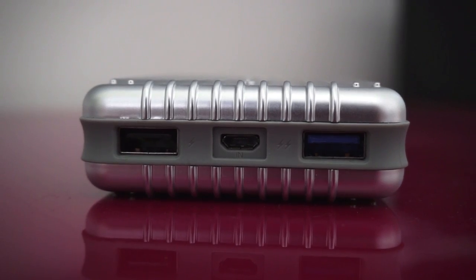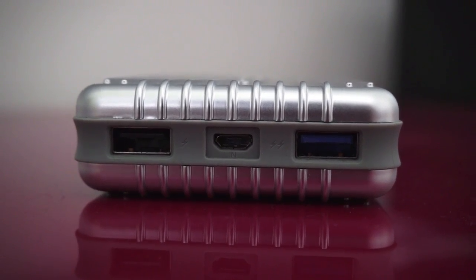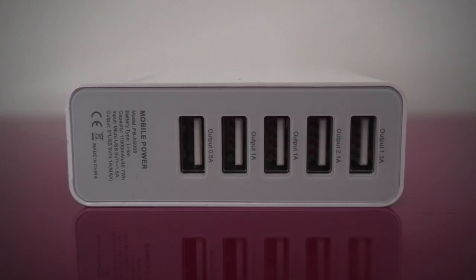If you're lucky, your battery will just list the amount of power each port provides in amps, like this one. Most smartphones require a minimum of 0.5 amps to charge, while some need 1 amp. Tablets often require a minimum of 1 amp and sometimes as much as 2.1 amps to charge. You can still plug in smartphones into these higher-powered ports — in fact, they'll charge faster if you do.